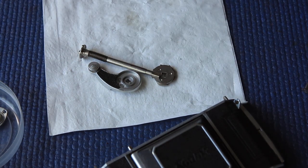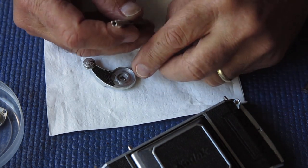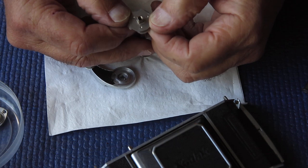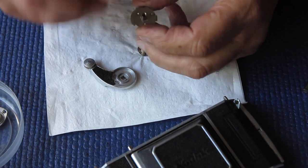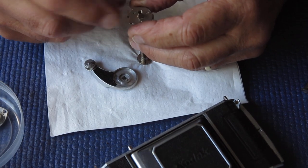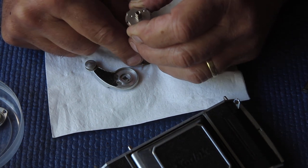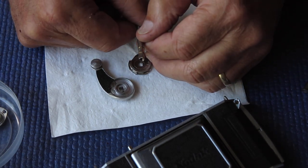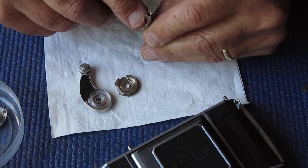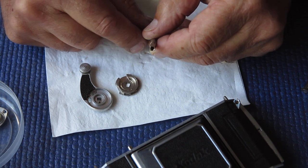I think that's probably okay. I've seen some that are quite noticeably twisted, in which case I have to untwist them, which is a bit fraught. Basically I have two components — one that can be set into the vice and another one above it with flattened-off sides that I can use a spanner on — and I fit the shaft in so it's held firmly with the bottom one by the vice, put the other component on top and twist it back the other way to straighten the shaft. The shaft here doesn't have much meat left — there's quite a large threaded hole running down the middle, very little metal left around there. It's not particularly strong.